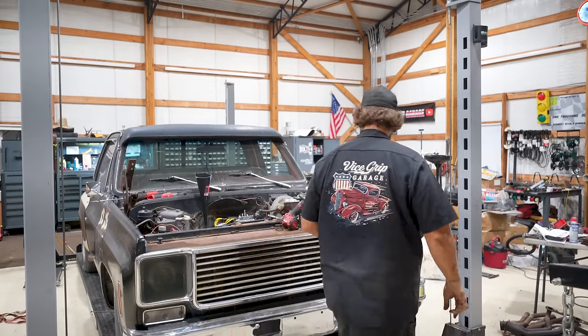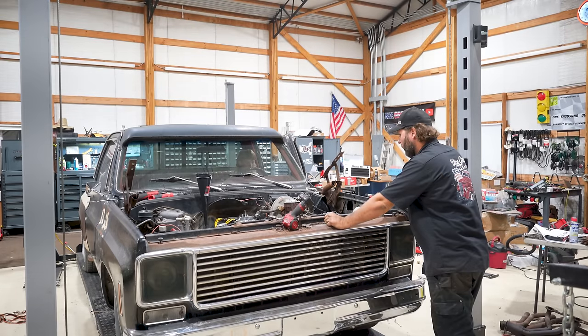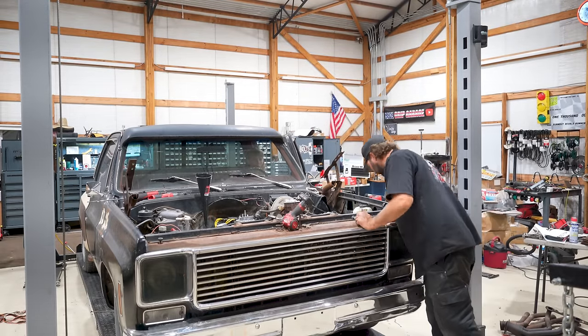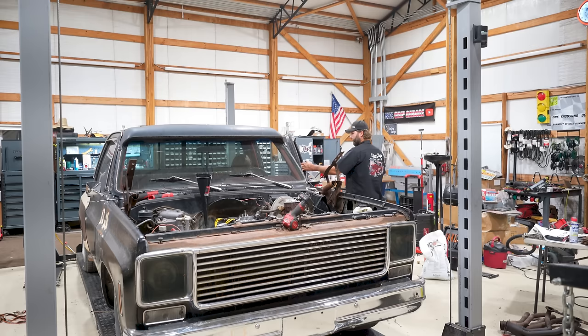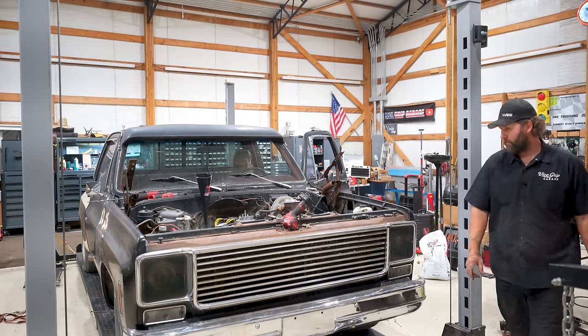Tap the key now, see what happens. Well, isn't that something? Pull the headlights out. Those don't work. Did they work before? I feel like one of them did. Is anything? Got any power anywhere? Not that I'm seeing. Try window wipers. Nothing there. Should we try to jump it? See if that's a problem. We ain't getting any juices anywhere.